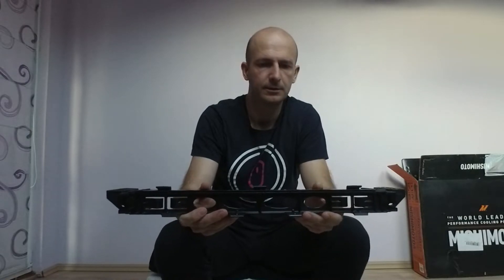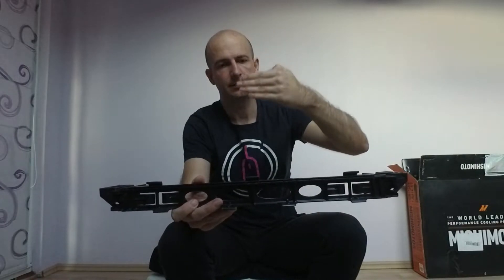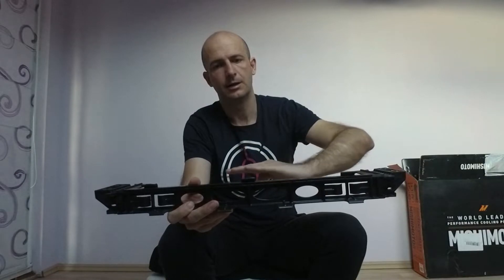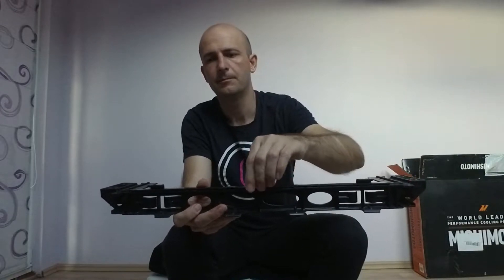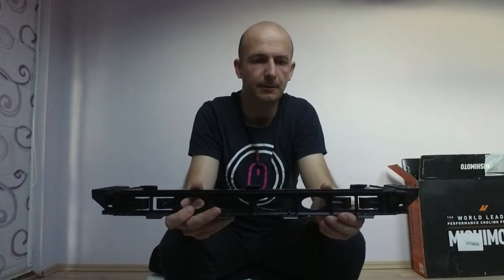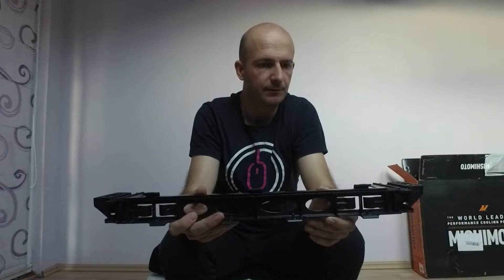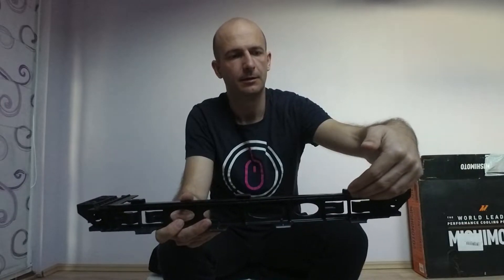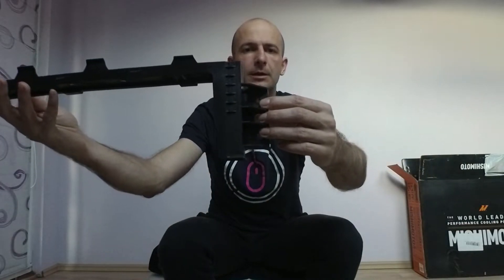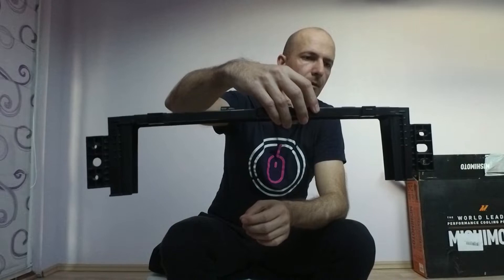The radiator needs to be fixed in this bracket. Basically, if this is the normal radiator from the car, the auxiliary radiator will be installed like this and will clamp on here to the plastic underneath. We obviously need to cut a pattern so it will fit. The bracket has some space for the bolts that will hold it in place.